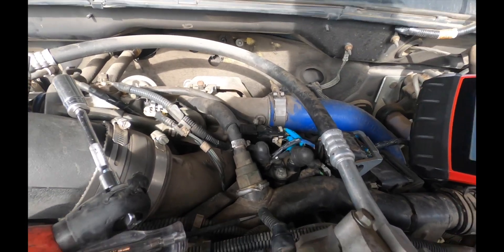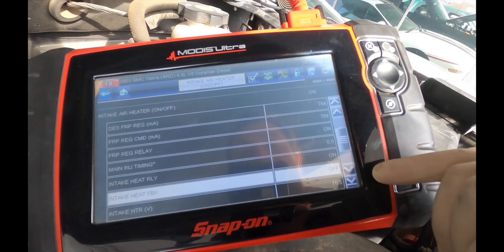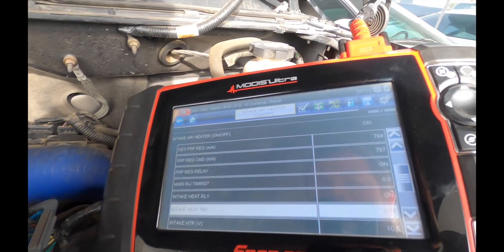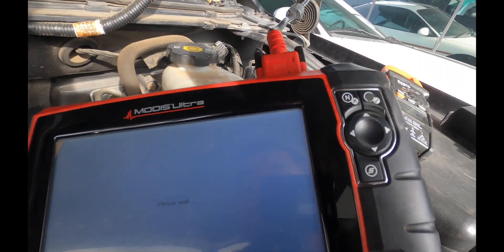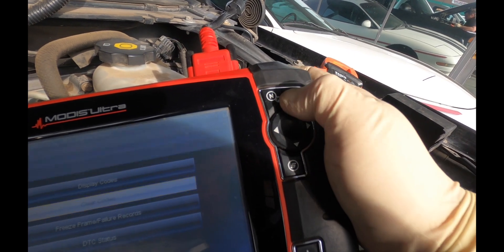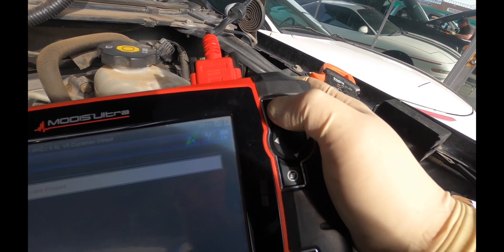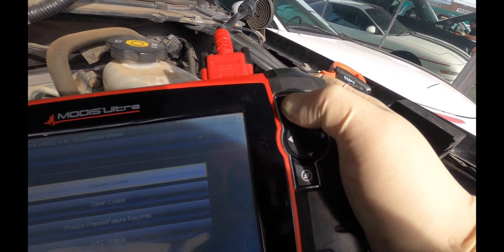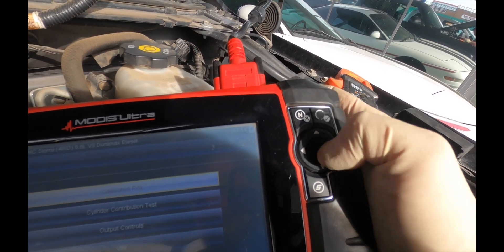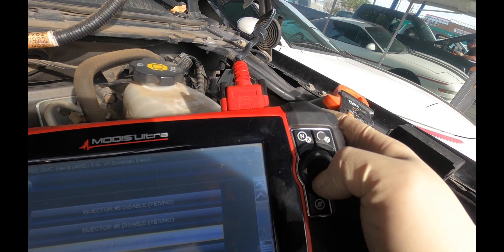Now we're going to go back. Everything's hot — we're going to turn on the intake air heater. Still no feedback. You know what, the reason why we might not be seeing that is because the code is still in there. I probably should have cleared it before. Let's clear the code and see if we have feedback. GMs are really weird — they won't do certain things. They'll kind of disable the data PID if there's a code for it. Like the EGR system on these LB7s — if there's a code in there it won't let you do anything. You have to clear the code to go back and do some testing and get correct values.